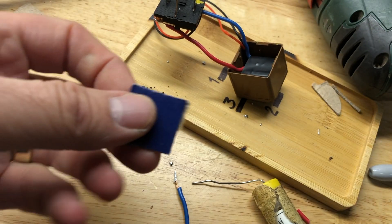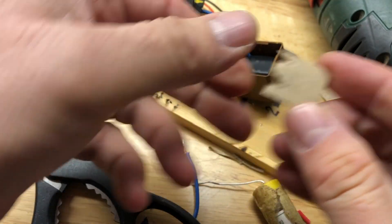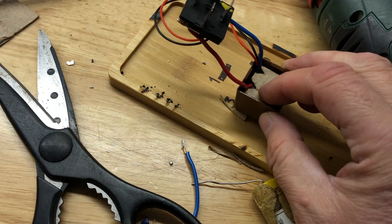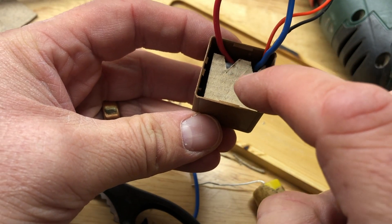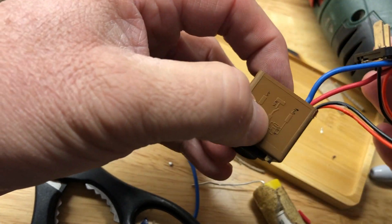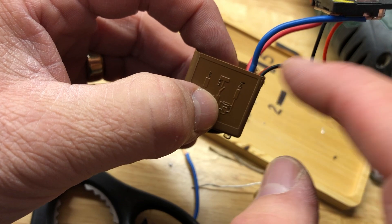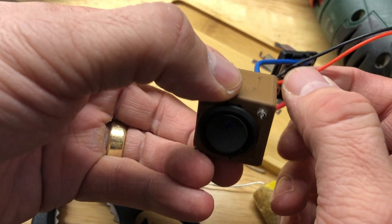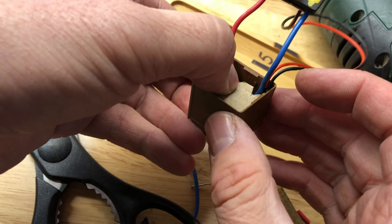Put a notch in the cardboard to let the wires through. That little piece of cardboard goes on top and effectively prevents any contact between the terminals on the switch and anything on the back. I've done this neatly and I know I can clip this back in — it'll be very snug. I want to leave it easy to open for future mods. I've tweaked the wires there — that's the soldering iron for you — so I'm going to actually tape around this.